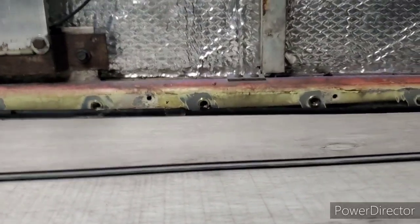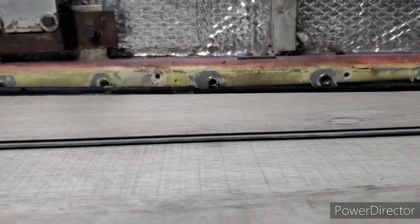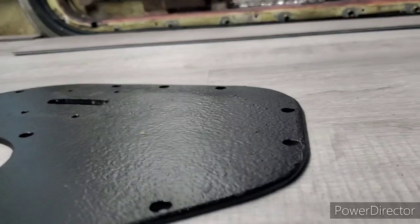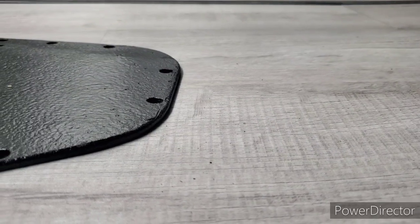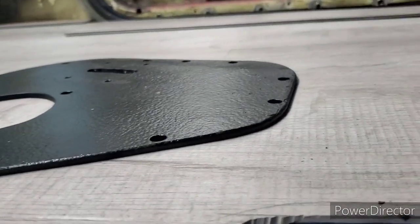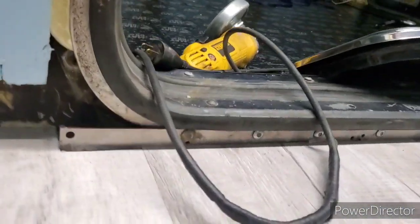And well, as you can see on that screw right over there, that's not flush. So if you were to lay this floor directly on, and I know I don't have that piece in over there, I got to trim it just a little bit more. But if you were to lay this floor directly on the bolts, and eventually it may snap if you step on an area where it's coming through, it's not going to turn out very well for you.